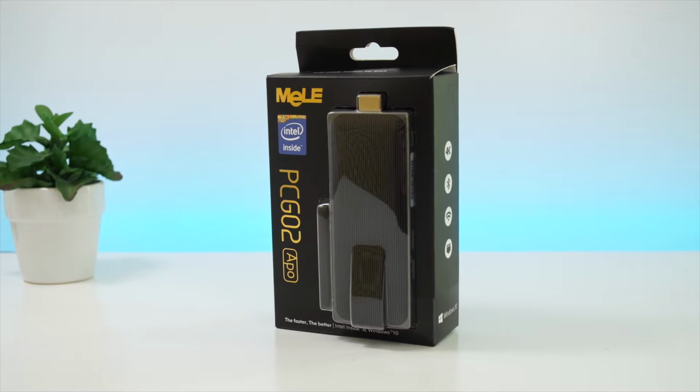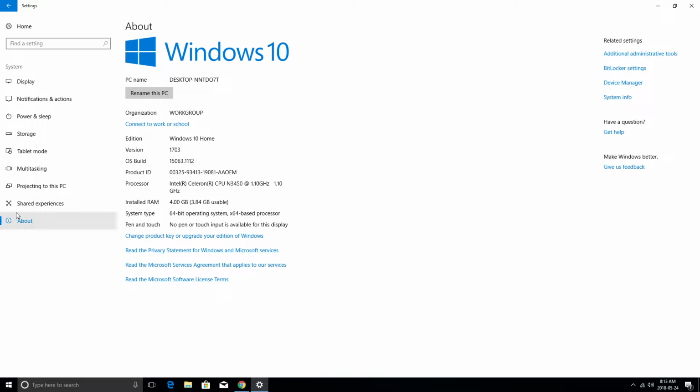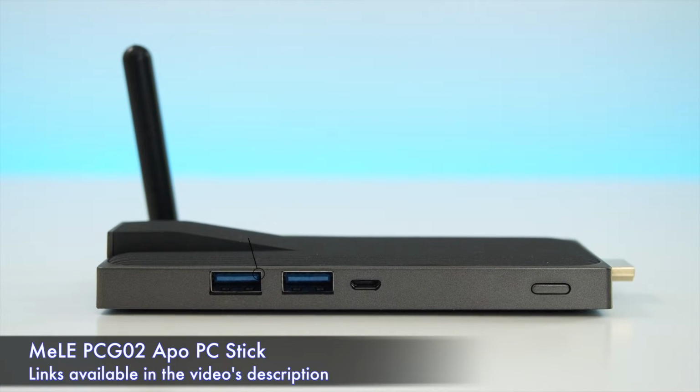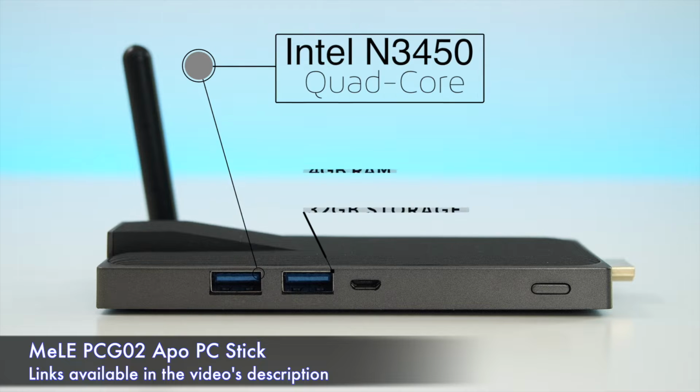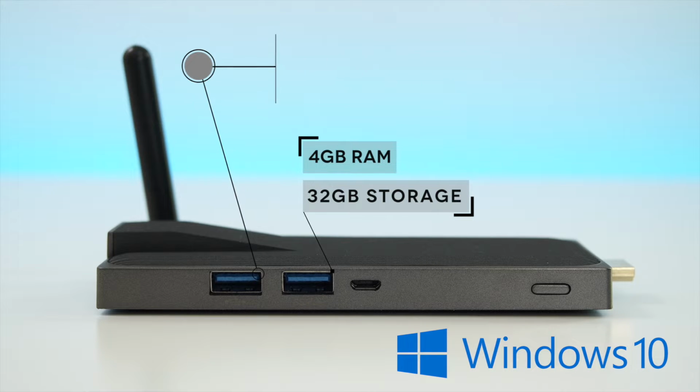and this particular one that we have today, it's made by a company called MeLe and the model name is PCG02 Apo. So this is basically a mini PC that runs Windows 10. You can get this for about $170, and for that price we get the Intel N3450 CPU, we get 4GB of RAM and 32GB of internal storage. Of course, you're gonna have some limitations due to that low internal storage,